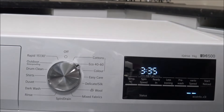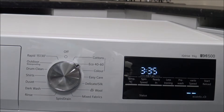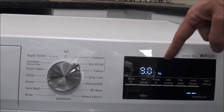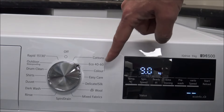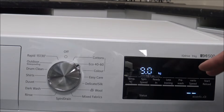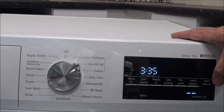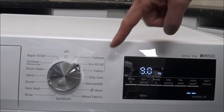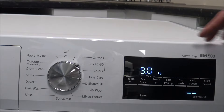The next main program for a full load is Eco40-60. This program is quite a new one and is a requirement on a lot of modern washing machines, so every washing machine should have this option. It's designed so that you can still wash a full load, but you don't normally have the temperature options — it's quite limiting in that sense. It will normally wash at around 40 degrees, and it's designed for clothes meant to be washed between 40 and 60 to be put in at the same time. It's quite a long wash — around three and a half hours — and you don't have the VarioSpeed option with this wash because it is designed as a very economical program. If you're concerned about water and electricity consumption but want really good wash performance and aren't too worried about time, then that's really the one to use.